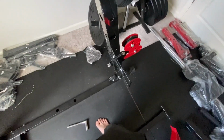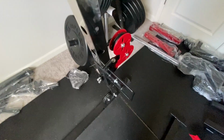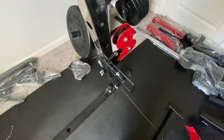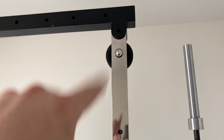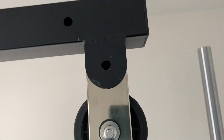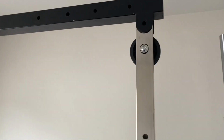Little points of adjustment down here, but this one, I just have leaning over here on the side. There's actually nothing holding this up since we just put 1 bolt down there. I just have it leaning against that pulley. So I need to grab this and pull it all the way over here. And it'll look just like that. As you can see, it's not perfect, but that slid into place, and that is put just to where the bolt hole is. So I can slip the bolt and washers through there, get that secured, and then we can start over here with the bracket to make sure that whole thing is secured.